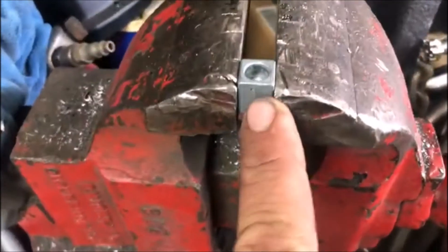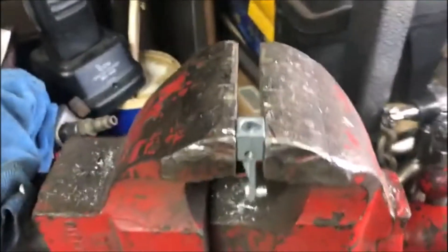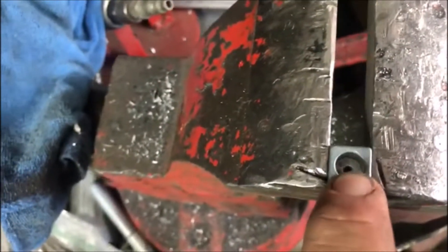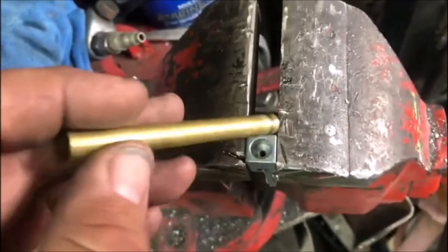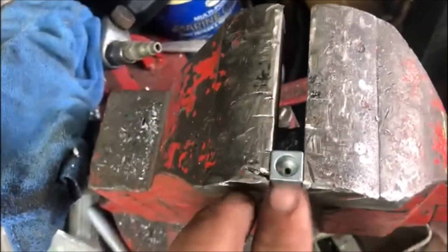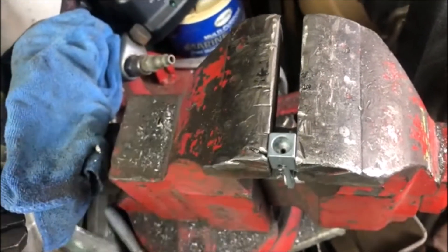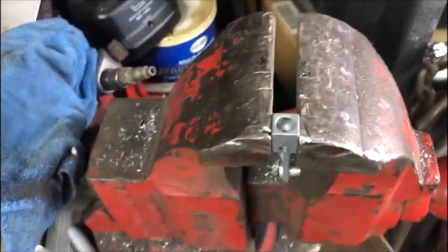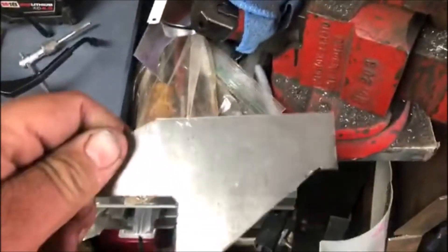This is the clip I'm modifying - it was holding the other throttle, a strange cable setup. It has set screws and lock screws here, and the cable went through there with an insert. I pulled that out and I'm going to drill this out as deep as I can go, then tap it so we can screw the 33c cables on. I'll put one of the set screws on just to lock it in place too. I'm going to take some of this steel and make another guillotine plate - I like that word, guillotine, that's the new word for today.